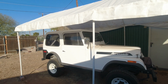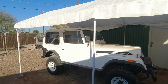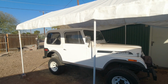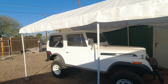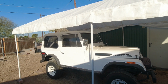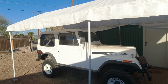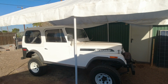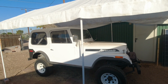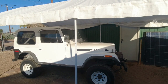So I have been out here working on this. Some things I really haven't gotten on camera and video that much. In the interior, I pulled it apart and I replaced the bad voltmeter. I installed a tach and I replaced the Bluetooth adapter. I had to pop the dash forward a bit to get to the wiring in the back, and I redid some wiring in there to the speakers and other things that wasn't making me happy, but that's done.